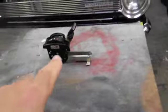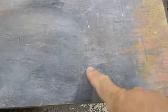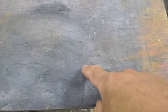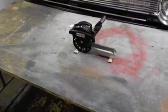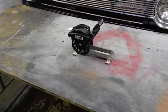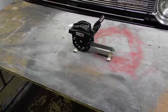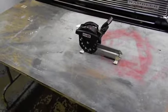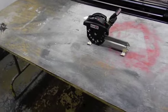On this particular unit, which is nice, the Chrysler transmission has a boss that sticks out the tranny like this, with a big hole in the center of it. It's cast as part of the tranny. It's pretty thick. Their bracket actually mounts to that. It doesn't mount to the pan on the oil pan bolts like the B&M stuff does. And then it's just their lever. And if you're still using throttle pressure, your original throttle pressure lever goes on top of it. And that's it. You're good to go. And it has nice adjustments on the cable.